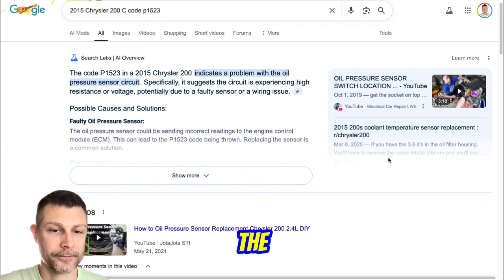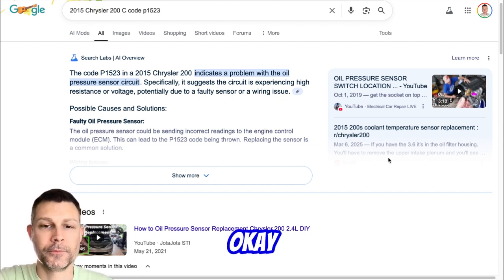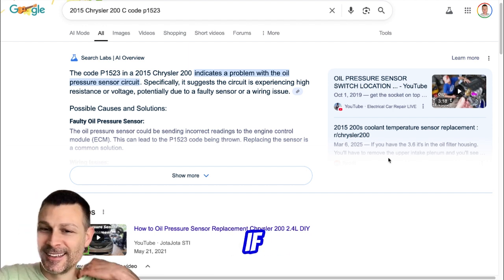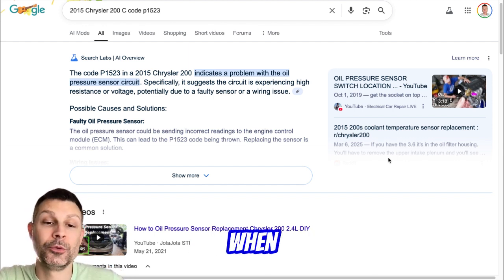A little bit of oil down each cylinder, crank it over with no spark plugs in, put the spark plugs back in, try it again. You got it. Okay. If the spark plug's out, it's just going to blow all that. What's that? If the spark plugs are out, how can it build compression? Well, it's not going to when the spark plugs are out.